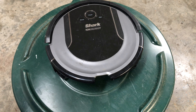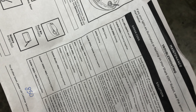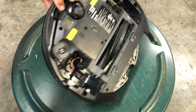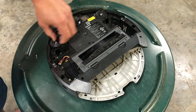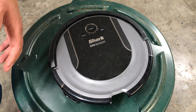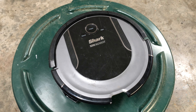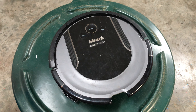Next: max plus exclamation point flashing together means a side brush is stuck — remove debris from the side brushes. It's one of two things: either the motors are going bad and one is sticking, so take them off, spin them around, and clean them; or the motherboard is bad. If removing them and spinning them shows they spin fine but the error persists, the motor itself could be bad.